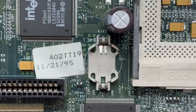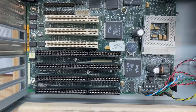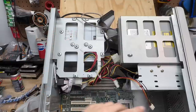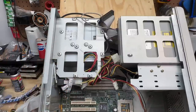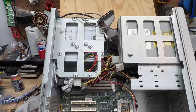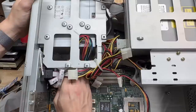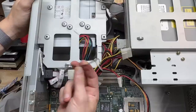In true VARTA battery style, it did leak a little bit. Let's get the new one in there. Here's a good look at the chips on the motherboard. I'm not sure, but we seem to be missing something here — I've never seen the inside of one of these machines before, but I wonder if that's where the hard drive's supposed to sit. We do have some screw markings here which seems to suggest there was a hard drive there. Let's get this power supply disconnected from everything — prepare it for interrogation. Got something in there — that's a bracket from a heat sink. Good thing I found that; it's a short circuit waiting to happen.